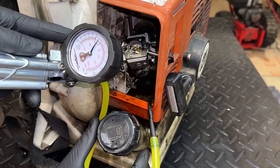I'm not sure how well you can see this, but if you look at the bottom of the jug, right where the writing is, all the way down to the base gasket, it's just covered in oil. It's nice and shiny. The bolts have oil on them. And if you look around the corner, we have more oil coming down the side here. So just based on the visual, I would say it's the base gasket that's the problem.